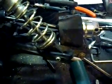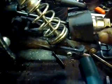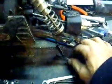You know, technically I could take that out and just shove that down inside, but it's starting to get to where it's going to rub on here, and it's going to hit when it gets up into full extension. It's getting pretty tight, so give it a little bit of space, take the stress off the knuckle, and keep some room for adjusting my camber.